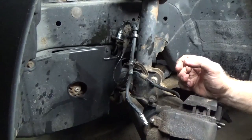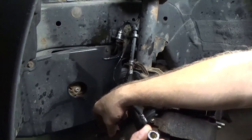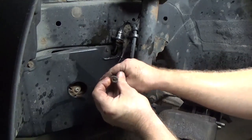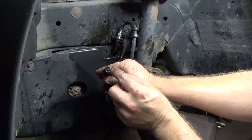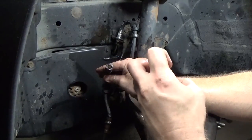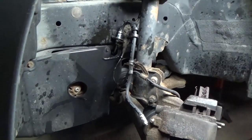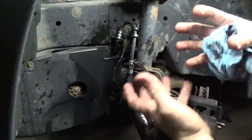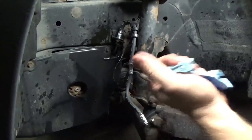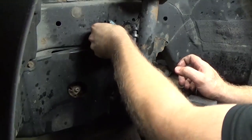This one actually uses a bubble flare — it goes in against that inner taper, so it's a different shape and we're actually forming that shape. Sometimes you'll tighten it up and come back later and it's leaking a little bit because that bubble flare wasn't 100% seated in its new seat. I usually just give it another quick yank after a short time — it's not necessary, just a matter of preference.